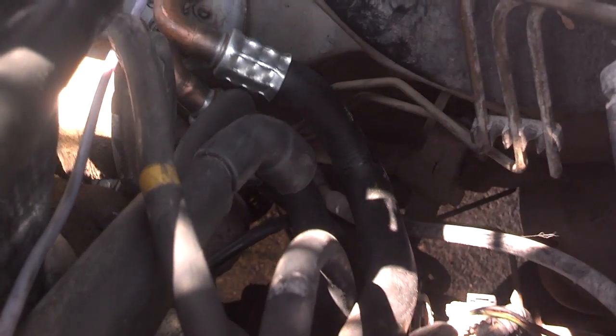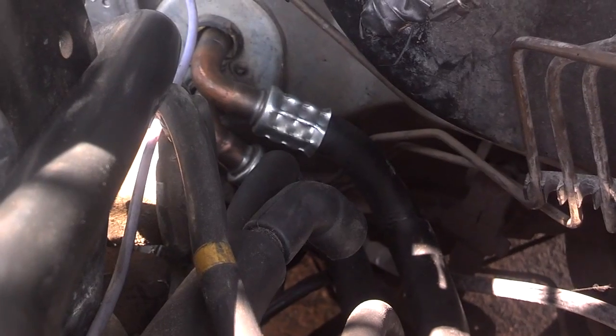This line coming off the top of your intake port on your intake manifold goes into this check valve here, and that goes back to your PCV hose on the base of your intake hose. So your intake hose has that hose off the manifold after that check valve. It also has your two PCV lines, your small one and your big one. Now that hose that goes back to that base of that intake, where it tees off after that check valve, it goes to your purge valve that has a plug there. The other end of it goes to a blue filter thing, and then that routes down under the vehicle. I believe it goes back by those hoses where your fuel pump is.